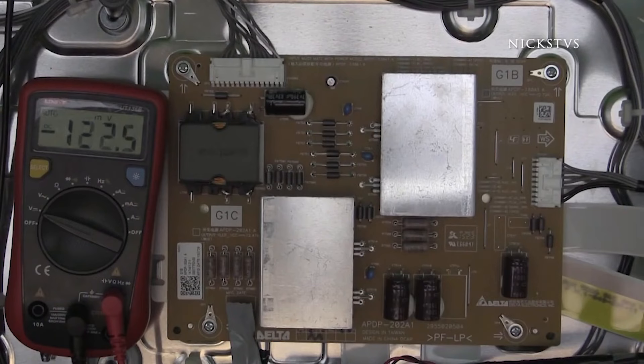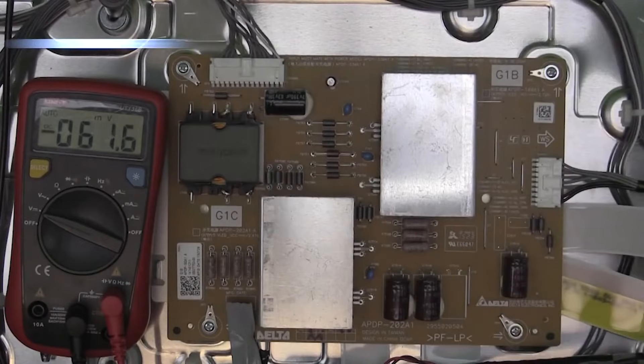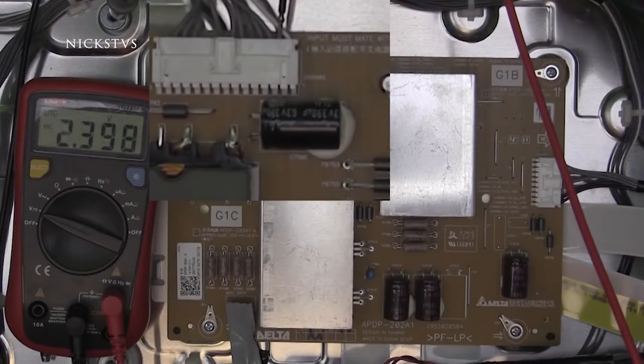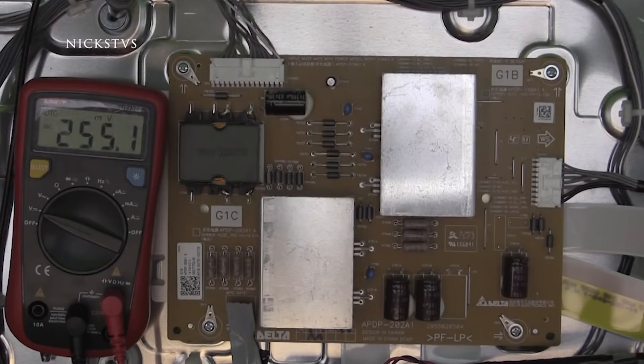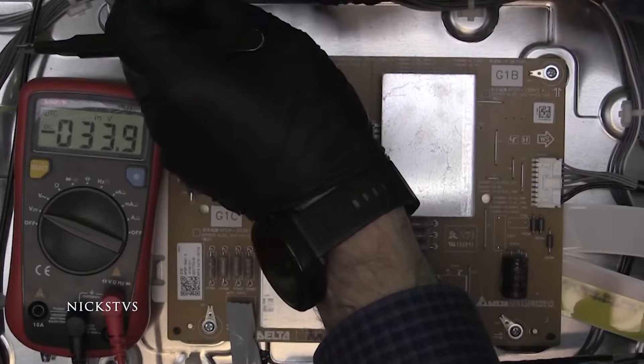We have the LED driver on screen and we're going to remove the error code pin — the wire that connects the power supply to the LED driver — and ground it out so the error can no longer be identified by the main board. We do a voltage measurement on pin two and get 2.39 volts, meaning it's detecting a fault, which is causing the 4 or 6 blink error code. On our example, pin two is the BL error; on different models it might be a different pin number such as six or eight. We unplug the TV and allow voltages to drop before unplugging the clip.